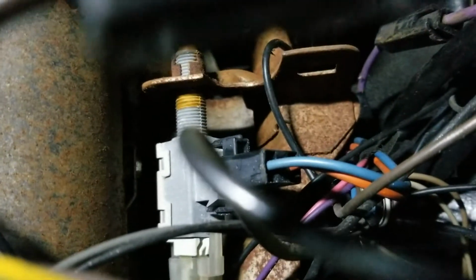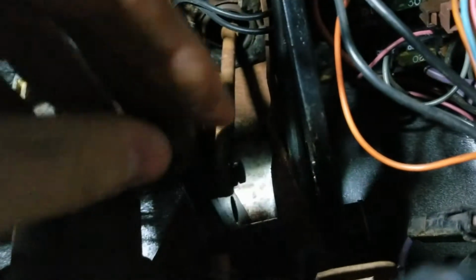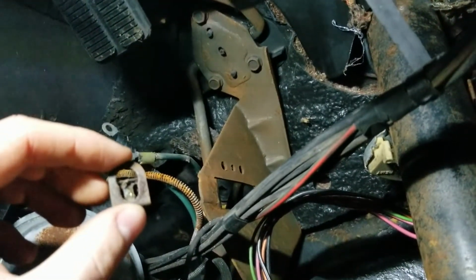And you just gotta get the bolt and shove it all the way through, and the nut goes on this end over here. And then, we got this here clip. You gotta make sure you get this bar, which is what actually goes to the brake booster, and then you slide it onto this peg on the new brake pedal. And get this clip, which I need light to see. You gotta slide the end over the big hole and then clip it on over.